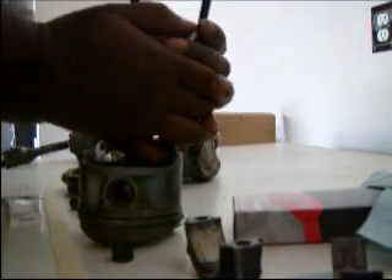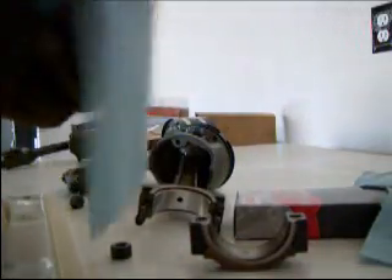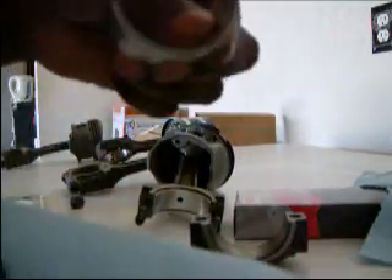Just like your mains, you press it on — there's a notch right here and a notch right there in the connecting rod, and you press it in. You don't have to go to the shop and pay $40 to have this pressed in. Any press work is $40 — I've had that conversation before, that's why I'm mentioning it. So of course clean out the bottom one, get all the oil off. You want the back of these to be as dry and clean as possible — mineral spirits would really come in handy there.